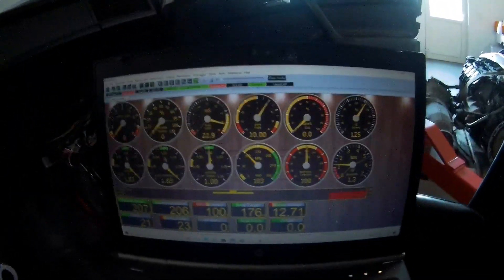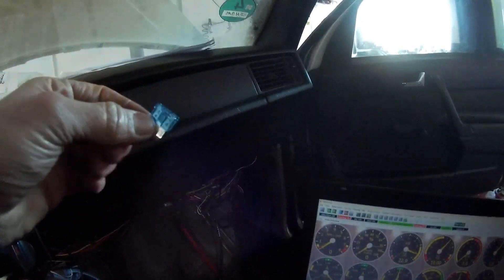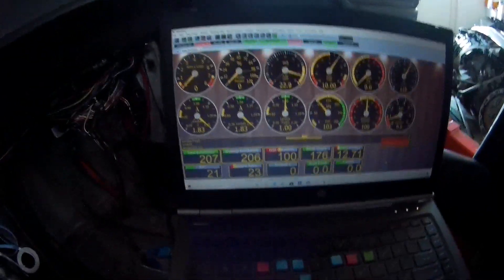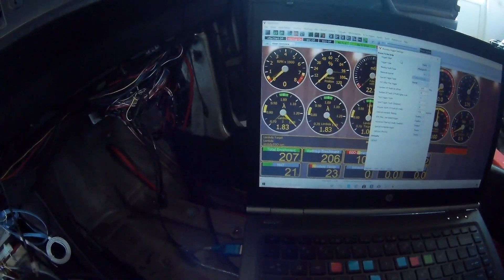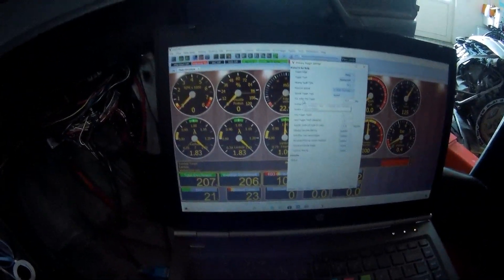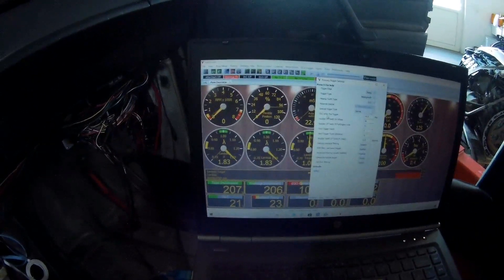You can also hear the fuel pump running. Normally it would inject fuel, but I pulled the fuse for powering the injectors, so that's off — it's all okay. In the ECU settings you can do a lot of things, like base setups and primary settings. In the last video I mentioned I bought a V8 trigger wheel — I will put pictures below on my website showing the trigger wheel and where top dead center is.